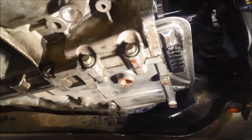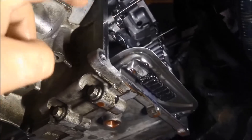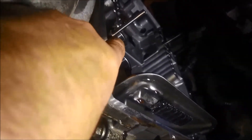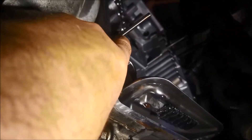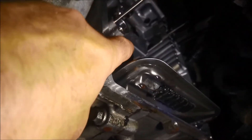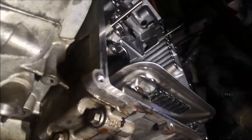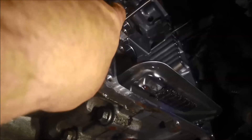A couple of things you can do to improve the situation. If you take that side cover off and take the valve body off, you can do a reverse flush. On this, the top hole is the pump inlet and the bottom one is the pump outlet. So we're going to reverse flush through the filter, through that top hole there where that pin is.